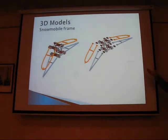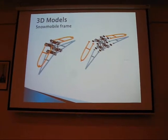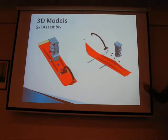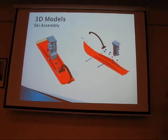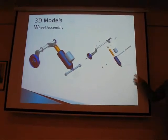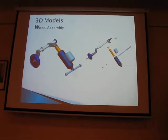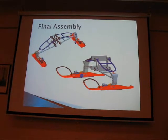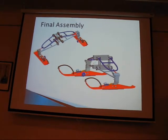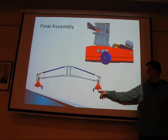Here's a snowmobile frame — it's supposed to simulate an average snowmobile frame and suspension. Here's the ski that it would be attached to. Ski mounts were difficult to make because each one looks similar but they're left and right, so designing them to be exactly the same was dimensionally difficult. This is what you'd be purchasing — the full assembly with bolts, linear actuator, axle, and all the pins. Here's the final assembly with the skis. You can see the carbide runner and the bolts on the ski. Here's an image of the wheels in the down position, showing just enough that the runner doesn't scrape the pavement.